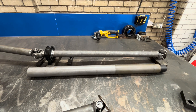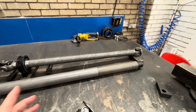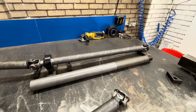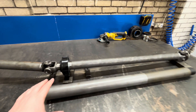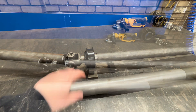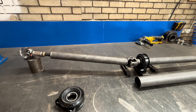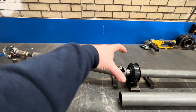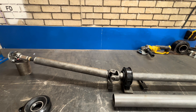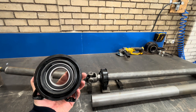The prop shaft itself — this is an 1140 series prop shaft, 23mm cap. It's a smaller series, good up to probably around about 200 brake horsepower, there or thereabouts. But they're quite good in kit cars because they're quite small form and quite light. It means all these components can be kept small enough to fit inside a tunnel. So you do have a few angles to check out. When you're looking at what you can fit in your vehicle, you'd have to make sure there's enough gap all the way around it from your diff past the center bearing and up to the gearbox. This bearing here is around about 110mm diameter.